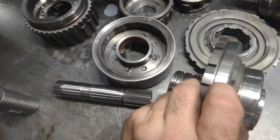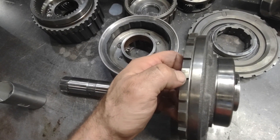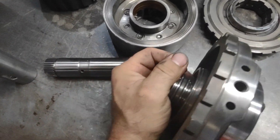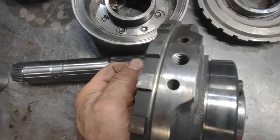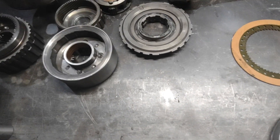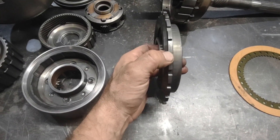The splines sit against steel with a snap ring on the front holding it down, indexed in the case on this machined portion. Anyone who has ever built a turbo 400 knows this is a very tight fit — a lot of times you have to do some deburring and clearancing to even get the center support into the case. Additionally, the center support is bolted in with the feed hole for second gear — it's threaded with a hollow bolt that holds it secured into the case, keeping it centered and tight, not jerking around in the case at all.